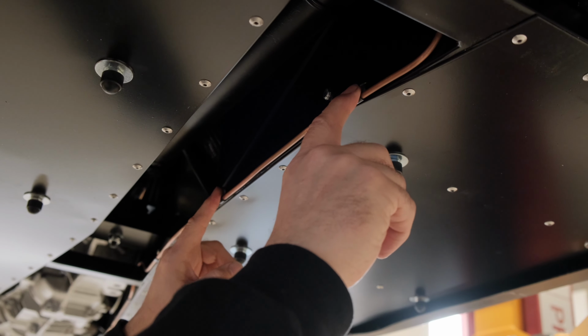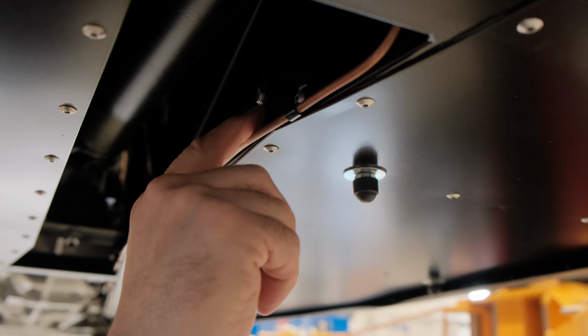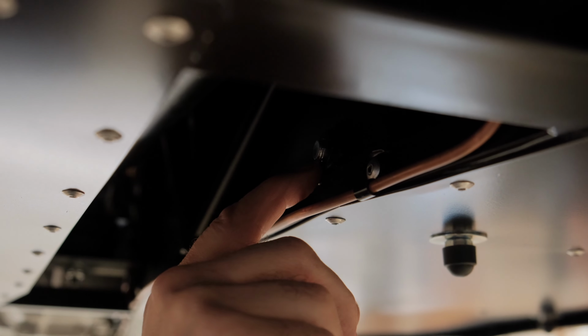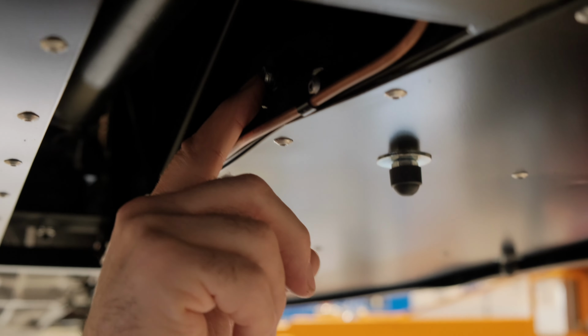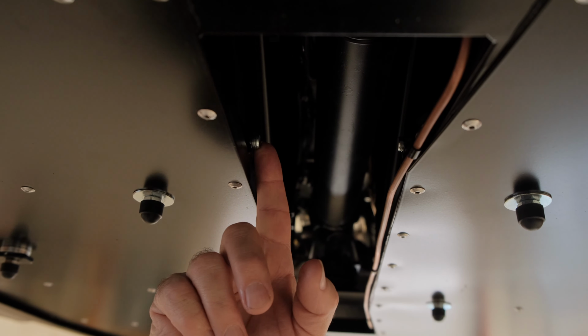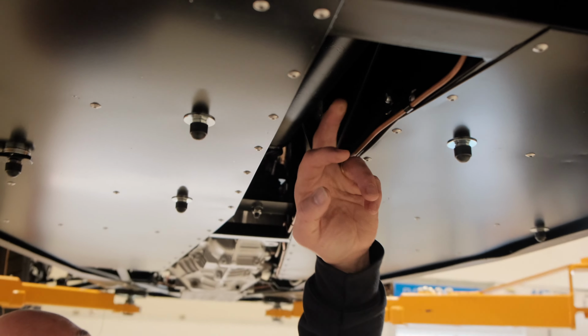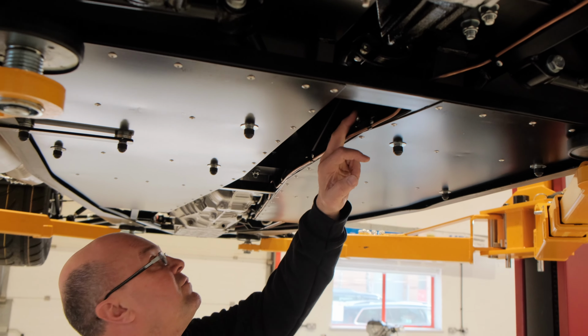and 200mm. They will check here that the seatbelt fixings, the anchorage here, that the bolt has gone through the thread here, so you've got the 2 points here. They may make sure that that's gone through and it's fully penetrated. Again, if there was not enough thread through there, which it comes as standard anyway in the kit, but if you did choose your own route, making sure that they go all the way through.